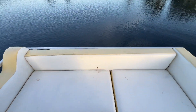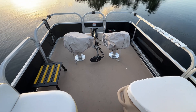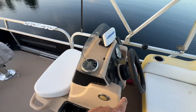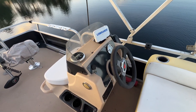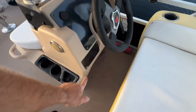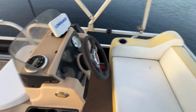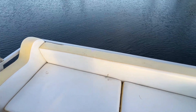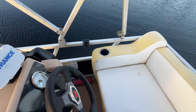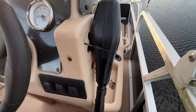I did sell that motor, and also had to sell the trailer because this boat is basically never coming off the lake again. So what I did for power at first is just use the bow-mounted trolling motor. I kept the controls for the steering, but when I sold the motor, the throttle, the shifter, and all that stuff went along with it, along with the ignition. But I kept the harness for all the electronics. I had a Newport Vessels 46-pound thrust trolling motor and I remote-mounted the head as you can see here on the side of the console.